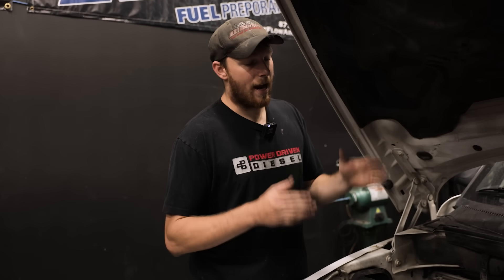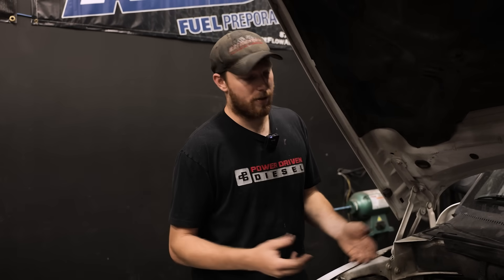So really you have two options: option one is use a j-hook — basically a turnbuckle that you use to hold the gate shut, which disables the gate completely. I'm not looking to do that. What I'm going to try to do is just tighten up that wastegate actuator a little bit so it has to build up more boost pressure to be able to open. It's a more involved version, but I think it's the right answer. Right now it made 18 pounds — that's not a lot. If we can get up into the mid-25s, we can see how the truck acts with that.